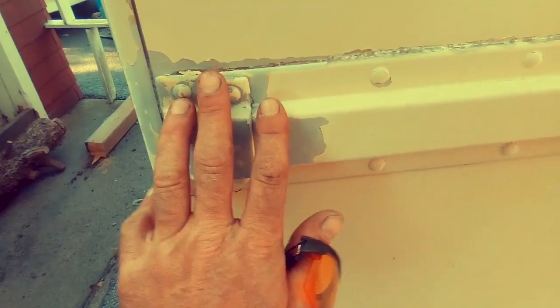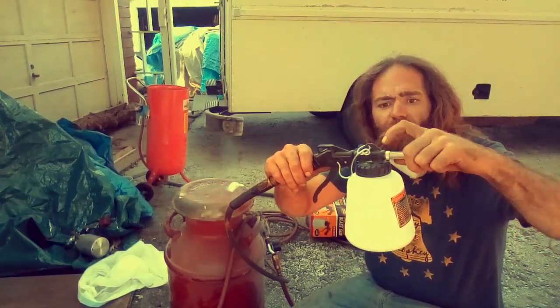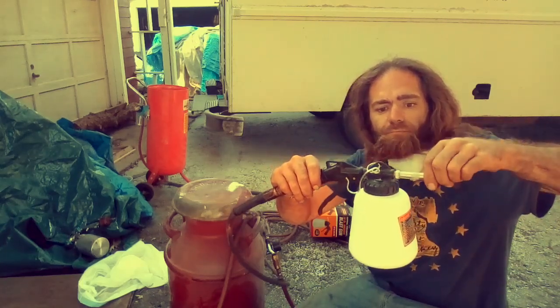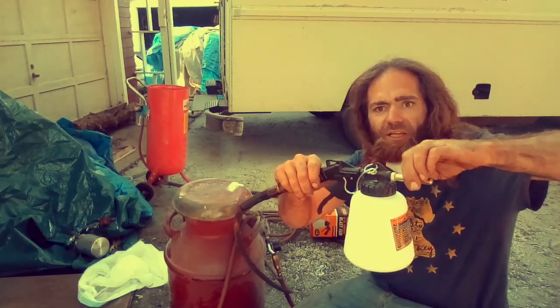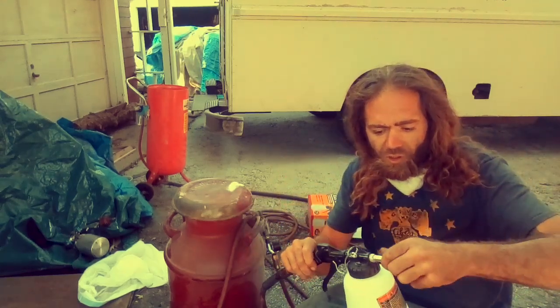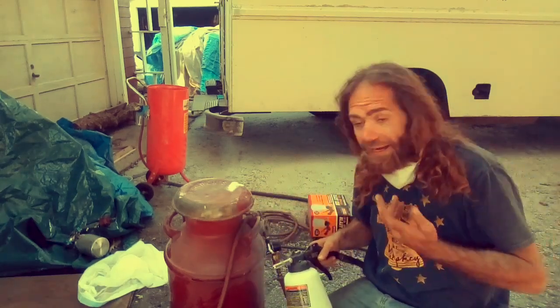This tip is adjustable — when you loosen the nut and turn the sleeve in, it's a control valve for how much it's cycling off. So try backing it out a little; maybe I've got too much pressure.